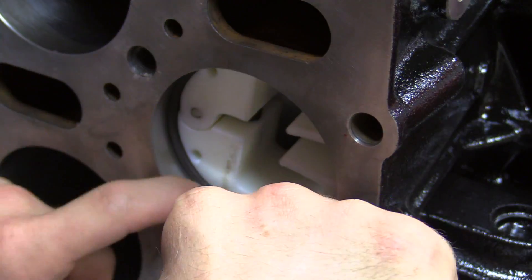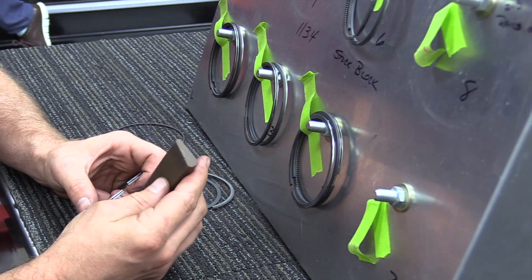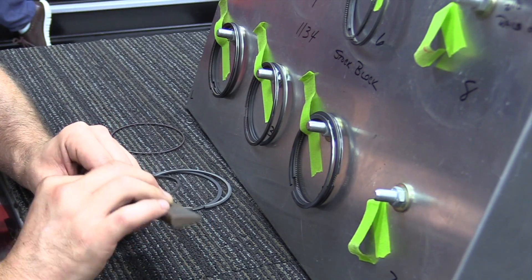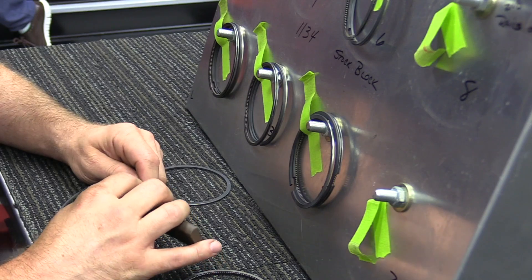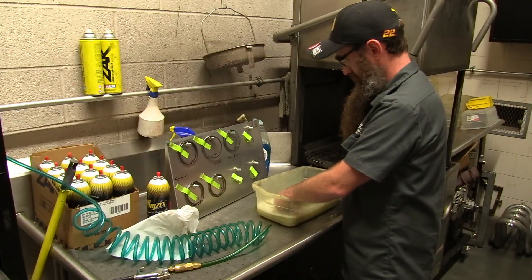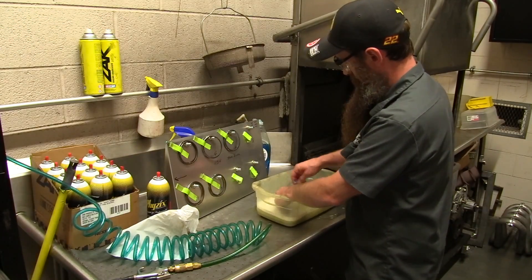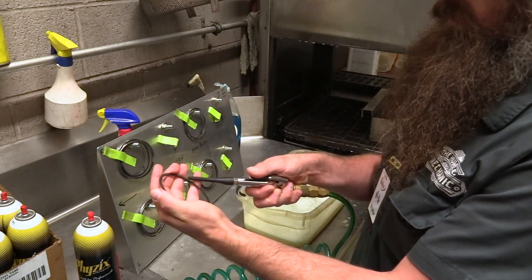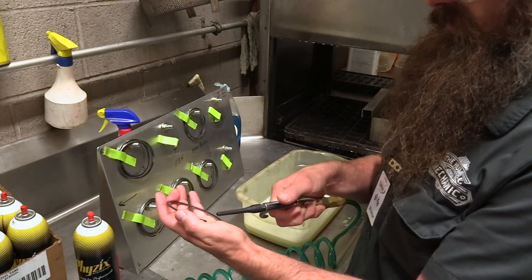We're going to do this for the upper ring, the middle ring, and of course the oil control ring, then do that for each cylinder. It's important to make sure that you're organizing these piston rings based on the cylinder that you measured them in. After we've measured all of the piston rings and made any adjustments to the end gap, it's time to do a quick deburr. This reduces the chance of scratching a cylinder. After deburring, give the rings a thorough cleaning — dish soap and hot water work best. Make sure that after they're clean, you dry them very thoroughly and immediately, because these steel rings will rust incredibly fast. Keep them in order and stay organized.